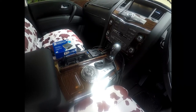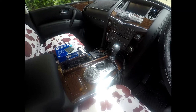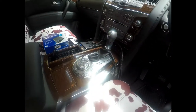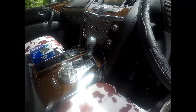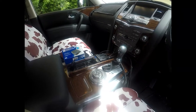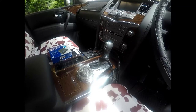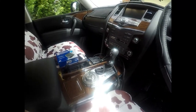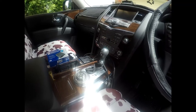If you're keeping your vehicle for a few years and not going to change your brake controller regularly, just get a permanent one fitted — sitting there looking ugly for two or three years would be horrible. You could do a tidier install under the dash somewhere, but it's supposed to be portable, so you'd expect it to be a bit tidier. It does what it says, looks pretty secure, we've tried it with the caravan and it works. As a quick in-and-out job you could just trail it out the boot, but we didn't want the cables rubbing on the bumper — it's a new vehicle. We put it through the floor grommet and fed it through as a temporary measure.